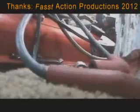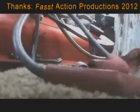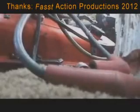And my other theory is when it comes to these old engines, these small blocks have been around 30, 40 years, the pieces, valve covers, timing covers, oil pan stuff, been on and off numerous times. They get warped. The bolt holes get wallowed out and pushed in and out, and pan rails and things. Rails might get a little warped here and there, making sealing them up a little bit more difficult. So this is something I think I may have learned. I wanted to share with you all.